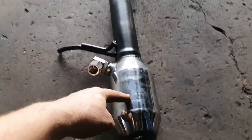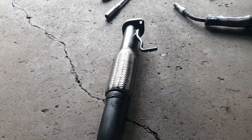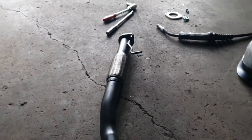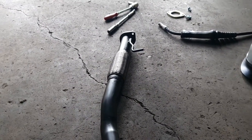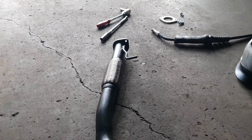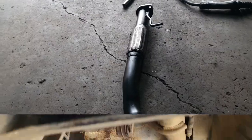There's our cat pipe. It's got a 100-cell high flow cat converter - that's our cat stopper like we spoke about. All the original hangers are reused and I'll put a rather large flexi in there. This thing goes - it's a dedicated off-road vehicle so we want it to last. I don't want any breakages. Put that back up in the truck - can you call a Jimny a truck? We're going to call it a truck today, it's truckish. I'm going to fabricate the next bit.